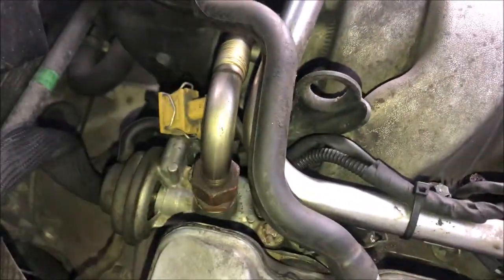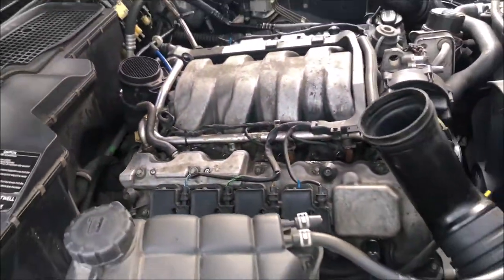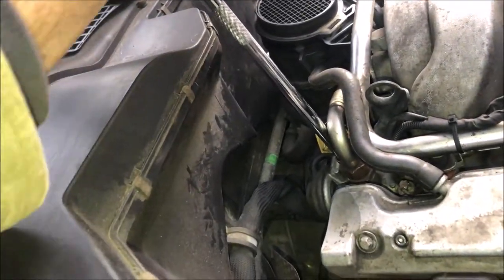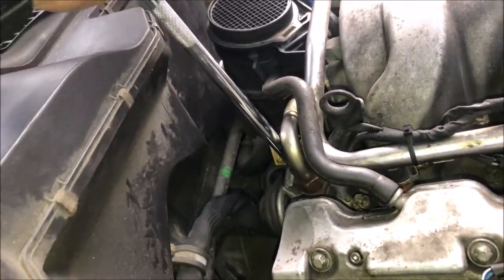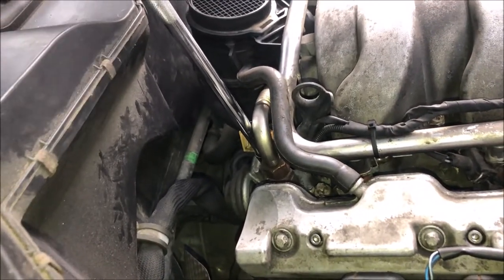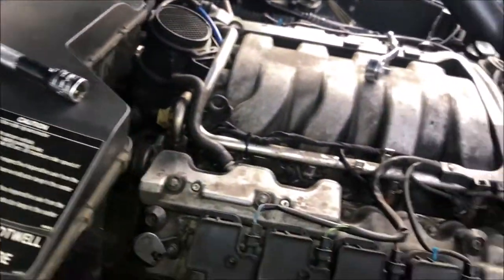I'm going to take off that top bolt, and then I'll figure out what size that Allen key is. I can't remember. Okay, so just removing the E12 Torx bit. They're on there at about, what is it, 15 foot-pounds maybe? Something like that. They're not very tight. Oh, sorry, compressor. I'll go turn that off while I'm taking this bolt out, which we are going to put blue thread locker on when we put it back in.